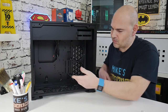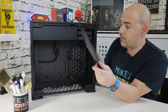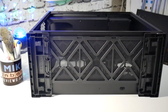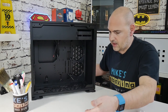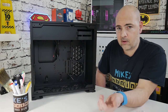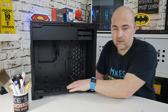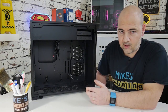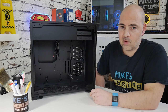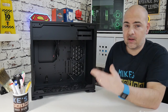At the bottom there's a full-length grille and filter which is removable and washable. The design is really good because air comes in from the bottom section, then travels 90 degrees upward, which does reduce some airflow but also prevents dust — the dust is being pulled across and gravity helps it settle, so the mesh does a fantastic job picking up dust and dirt. I haven't had to clean the inside of that case yet and it's been on that shelf for maybe six months.